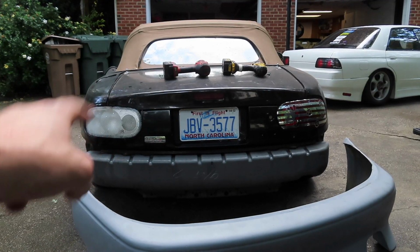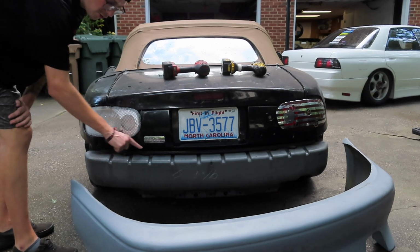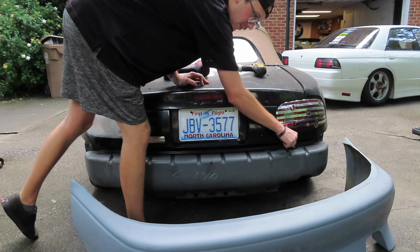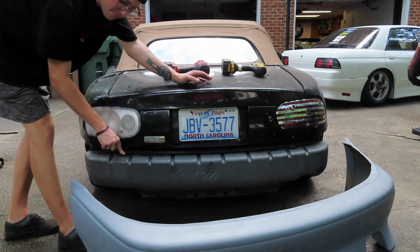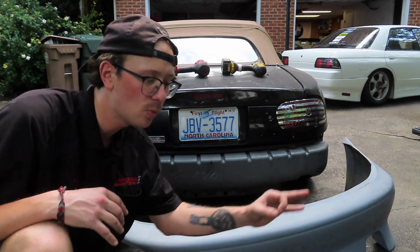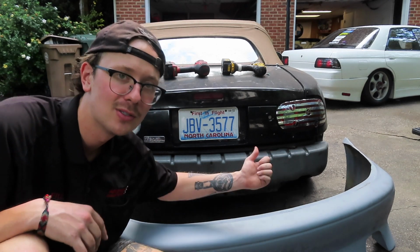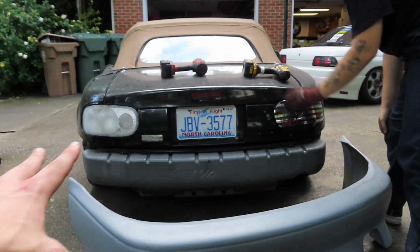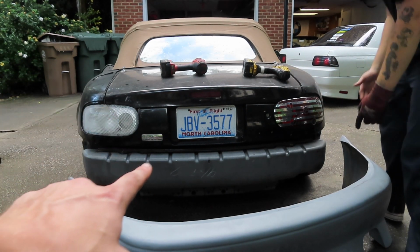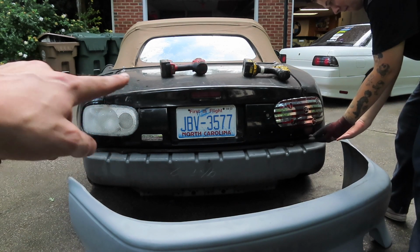All right y'all, so for the rear bumper, there's little metal fins right here on both sides. We're gonna send a self tapper through that one and a self tapper through this one. And again, when we put the kit on, once it's painted, we're gonna have sunken in hardware so it won't be quite as noticeable. Before we actually put the self-tappers through this bumper, we do need to drill the holes through the bumper itself since they're already drilled on the car.